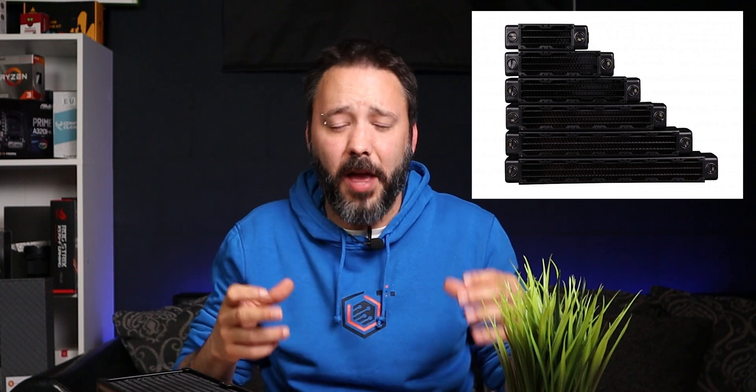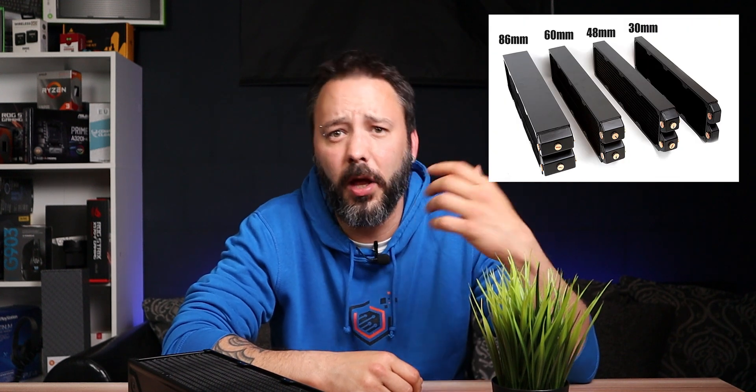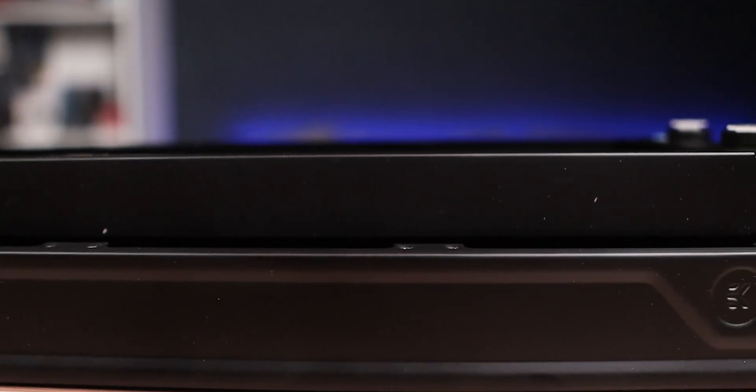You can also find more specific ones — for example, made for servers. They are really small but thick, especially used inside those 1U server cases that you all know. As for thickness, you can have radiators all the way from a slim one that is 20mm to the big beast that can be 80mm, with the most common being around 30 to 45mm thickness.